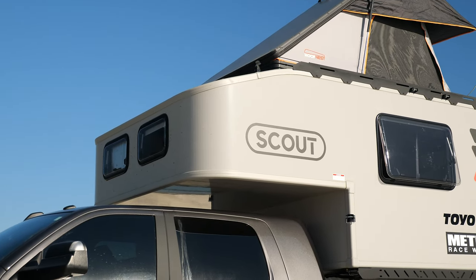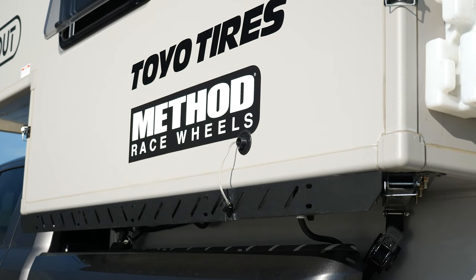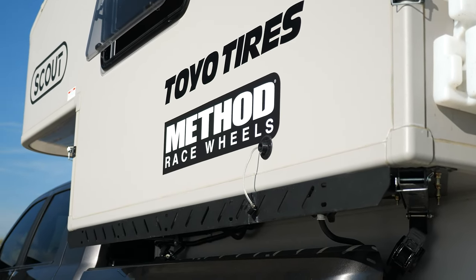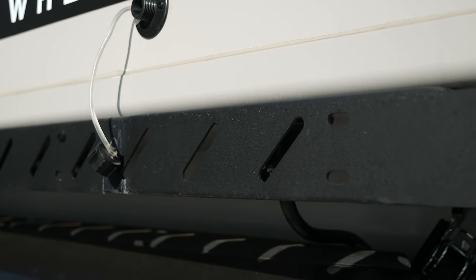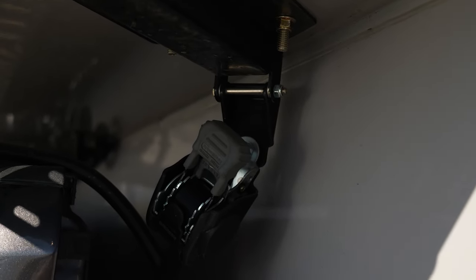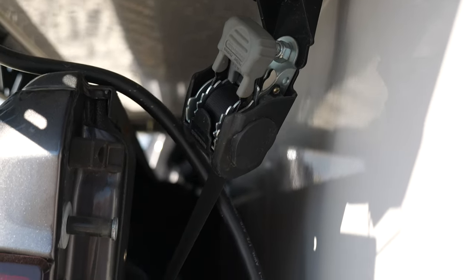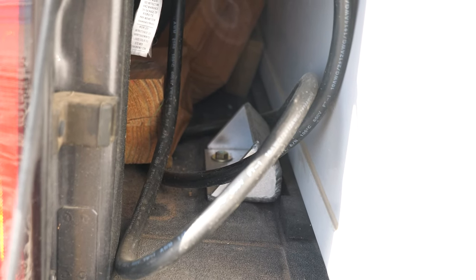We've been camping on the beach here and could still hear the waves with all the windows closed, so it was pretty nice. Another option on here is an accessory rail down the side of the camper — you can use that for mounting a shower cube, creating shade, a good anchoring point for a shade awning, or hanging stuff from the sides at camp. That drain you see right above it is for the sink on the inside — it's just gray water, soapy water. The camper is tied down by four ratchet straps. There's also a locator block, kind of a bracket that Bowen Customs made for us, which keeps the camper from sliding side to side — an aluminum piece bolted centralized in the bed. If you actually use your camper off-road, everything is held in place really nice and strong.